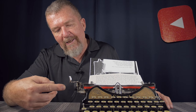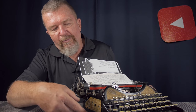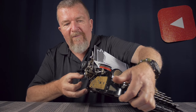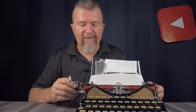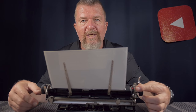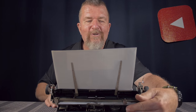The serial number database shows this typewriter as being from November–December 1930. The prefix letter on the serial number indicates it is the gold and black trim model of the Corona 4. Because of that 1930 year code, this typewriter also has dual carriage release — a carriage release on both the right and left side. My older Corona 4 didn't have the second carriage release, so it's a really nice feature.